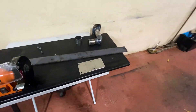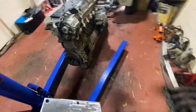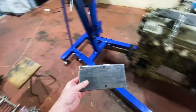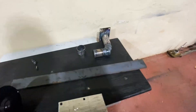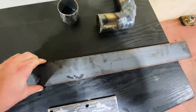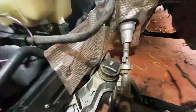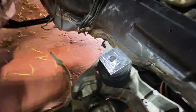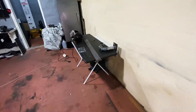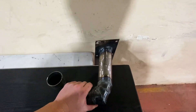Yesterday I went to the shops and I picked up some metal. So this is the plates that go against the engine — I'll show you over here. This one is on over there, I just have two bolts in but it's fine for now just to measure everything. And then I got this 70 by 10, pretty thick steel, that I'm going to be using to take it from the engine to the mounting. On the mountings over here I just have little squares, and then I'm going to bring it down from the engine onto them, maybe two of them.